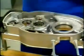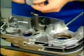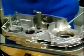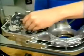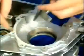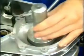Insert the transmission bearing 6204 and secure. From the transmission side, mount the lay shaft cap, sealing disc, and bearing 6203. Insert the oil guide disc with its punched mark into the open end of the circlip. Use a punch to fit the crankshaft main bearing. Make sure the closed side faces the crank chamber.